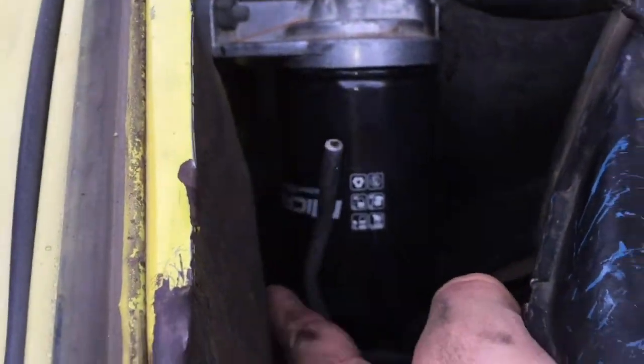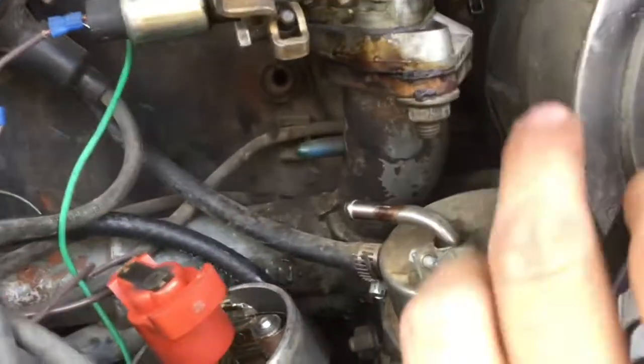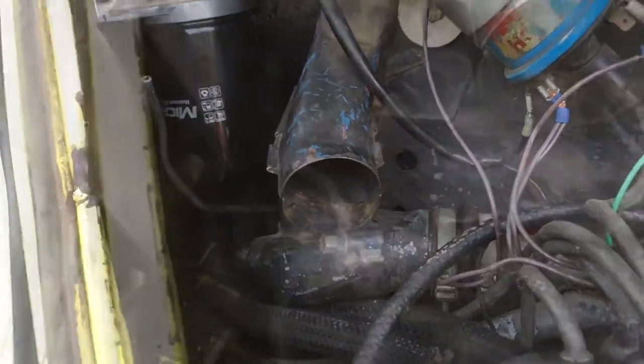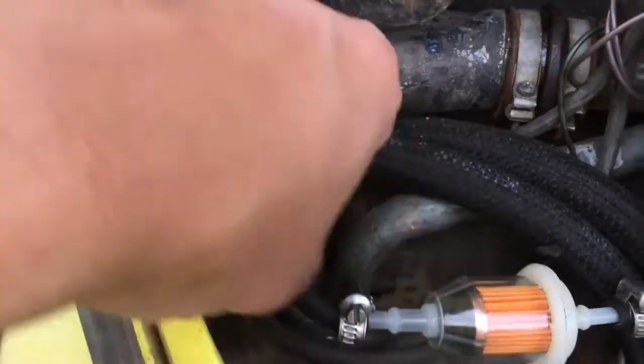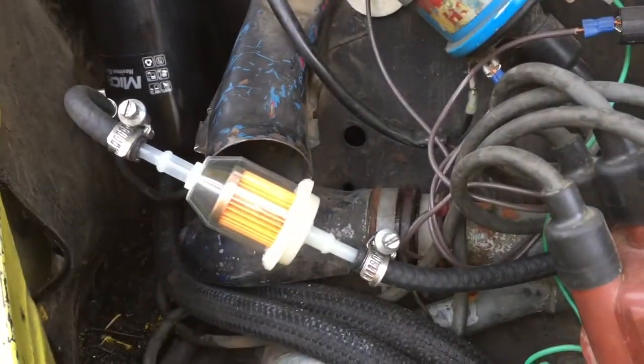Now that we're in the engine bay, you'll see here's the copper line — I've already removed the old tubing, and that goes into our fuel pump. We'll reconnect the new line and put a fuel filter between this line and this line here. You'll see I got the new hose connected to the copper tubing, and we've got the fuel filter here that goes through to the end of my fuel pump. After that you're all set — fill it up with gas and see how she runs.